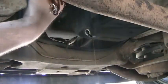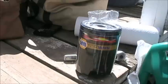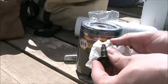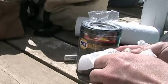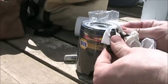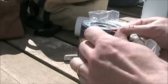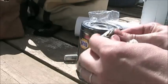Next we're going to come in with a rag and clean where the oil filter mounts to make sure that's nice and clean. Now we're up on the deck. Here is my oil plug — it has a magnet on it, and you can see there's not too much on there, which is good. It's just a little indicator of what's going on inside the engine. Since I wasn't the one who cleaned it before, I don't know how old that stuff is. But the plug looks good — threads are clean, and the rubber gasket is still intact, so this thing's ready to go.